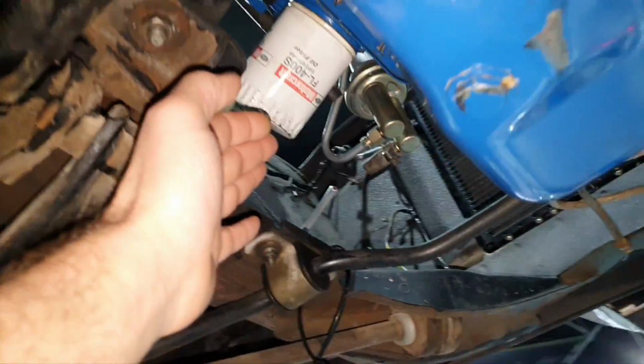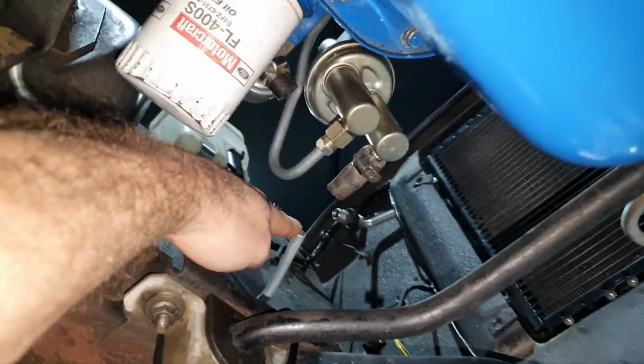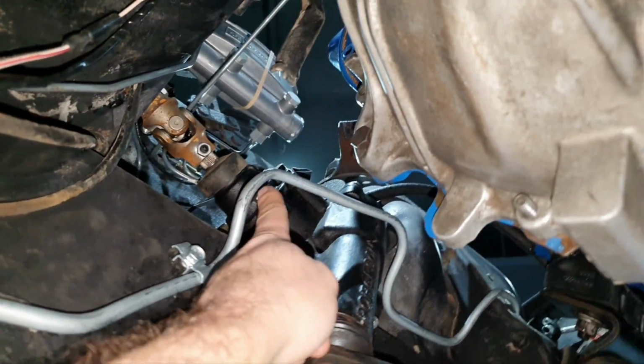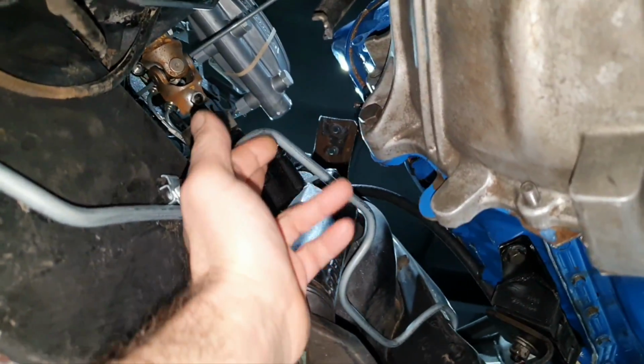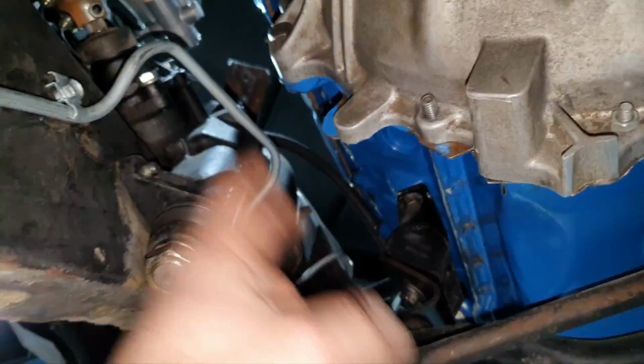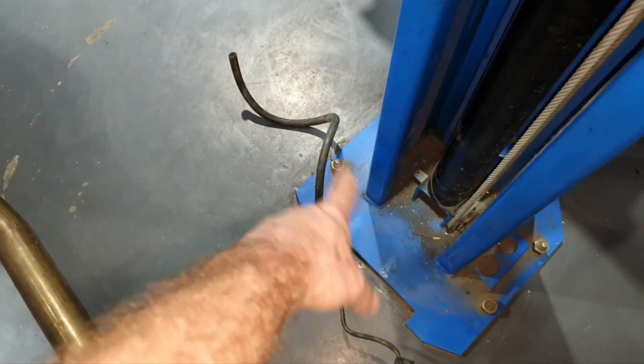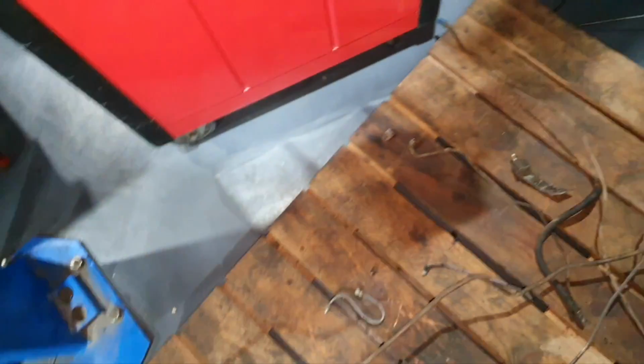Before it was the rubber fuel line. Now it's gonna come from here till here, one rubber piece only. Before, from this side where the headers were, from this side till front, it was a rubber pipe, not anymore. Specifically, it was this long line passing through the headers. I prefer to pass a steel line rather than a rubber hose through the headers. Headers are there, okay. What else?